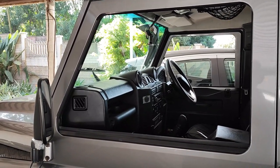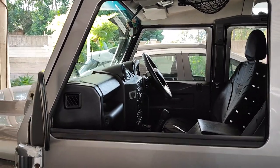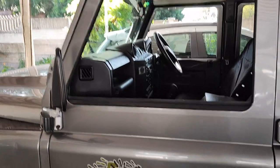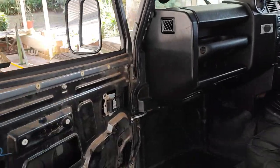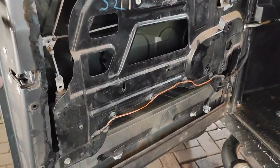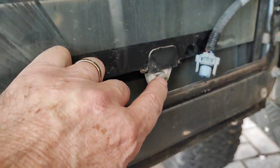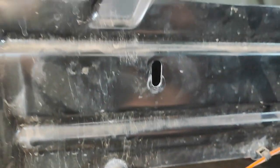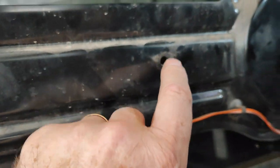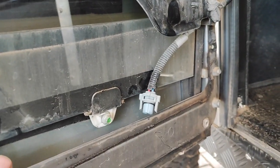This happened previously and I changed the mechanism on the right-hand window, so I thought I'd have a go at it and see what we can do. I've taken the mechanism out — sorry, I only started filming once I started the job. We got the mechanism out: these two bolts at the bottom, you loosen those, you don't have to take them out, just loosen them. Then it frees the mechanism — six bolts, one or two nuts, and the mechanism comes out along with clips from the electric motor that winds it up and down.